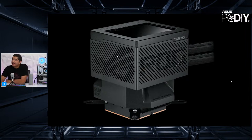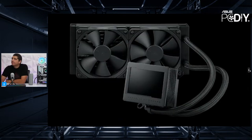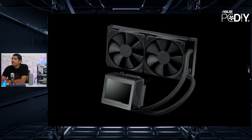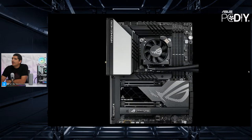Here you're going to see a lot of slats in the venting, and they're there because, of course, the unit has an integrated VRM assist fan, which helps to provide direct airflow to the VRM and that surrounding area. The Noctua fans, which of course come included inside the unit, and that radiator, like I said, 30 millimeter versus 27 millimeter. And there you can see the VRM assist fan.